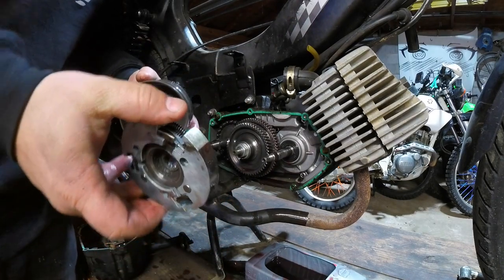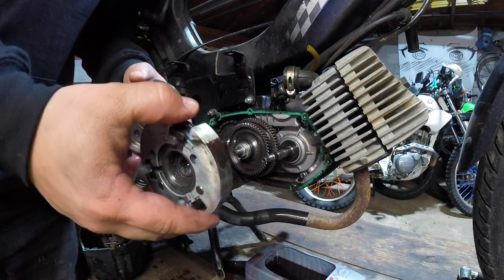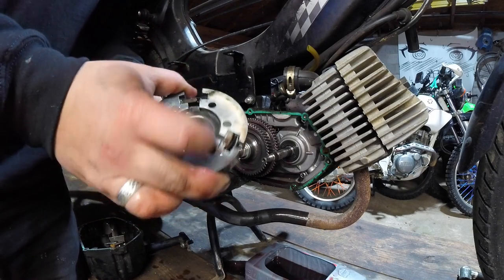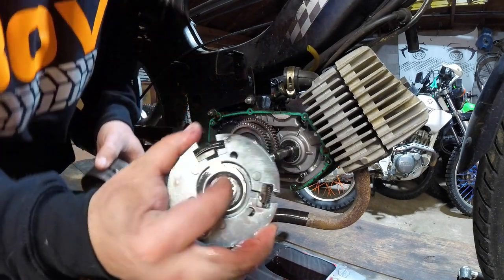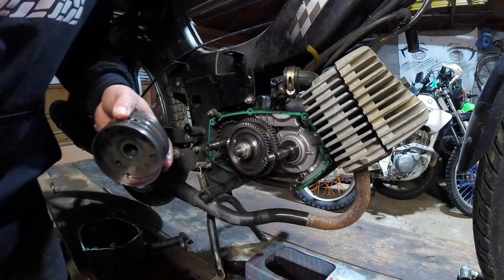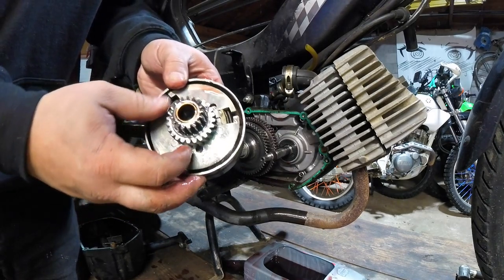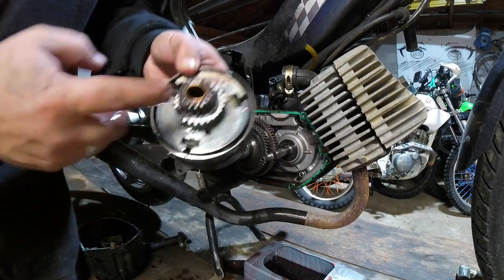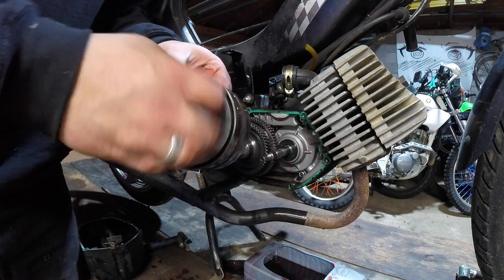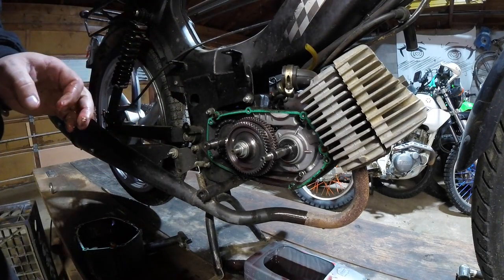Do not lose the shim — that keeps the clutch pack from going too far in. We're going to drop out first gear, and yeah, there is no clutch material left. This is just the teardown video; when we go into the rebuild video, we'll hit you guys up on how to repair this on the cheap. You can order the clutch packs but they are a little pricey for our budget. The actual unit itself doesn't seem to be damaged — it looks like it can be doctored up, and we'll get to that in the next video.